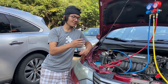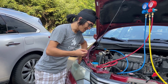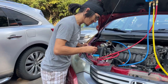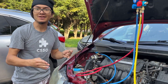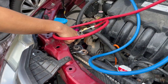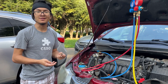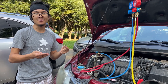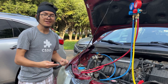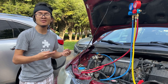This is important because Nafis bought this car used. We think what happened is the previous owner knew the AC wasn't working and did a patch job to make it look like it was — that's why it had such a huge washer, which actually hid the cracked hose receiver. My dad asked Nafis about the true story: Nafis initially thought the AC was working until recently, but apparently only one day after he bought the car, the AC stopped working — and he's had the car for several years.